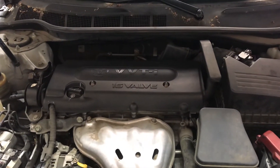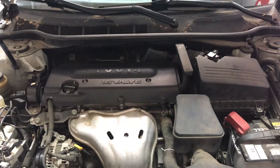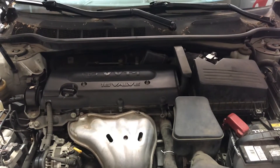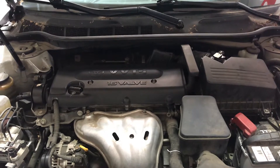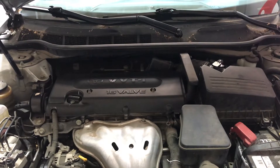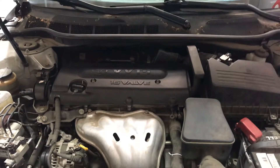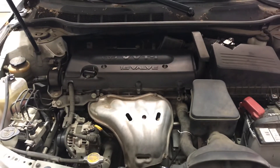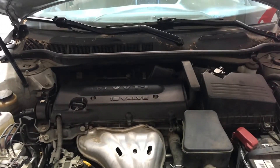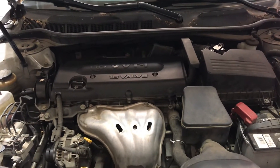In full disclosure for this video, I'm not going to actually do any work. I'm going to show you all the things I did that were right and wrong to fix the P0171 error, and this way I think it'll help everyone diagnose their own problems. The P0171 error code is not specific to a Toyota — this is a 2007 Toyota Camry — it's a generic code which really means there's a lean fuel mixture.